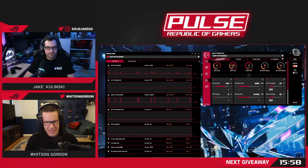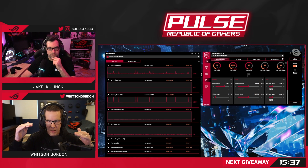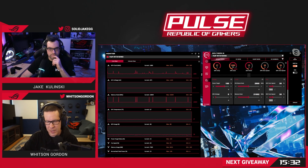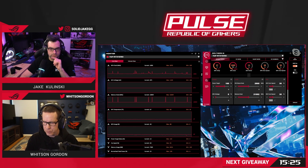The thing is, these days these cards — and CPUs for that matter — have such advanced boosting algorithms built in that the card kind of does a lot of that work for you based on its own parameters. It'll say at this voltage, go for this clock, but push the clock speed as high as you can within this temperature limit, this power limit, and this voltage limit. So if you're in a really cool area and your temperature's low, your card might be able to boost a little bit farther.